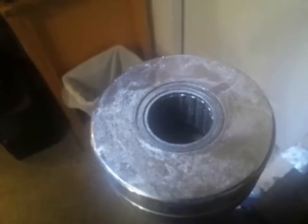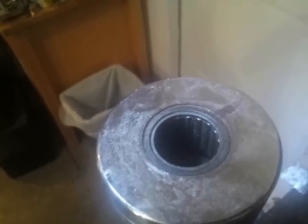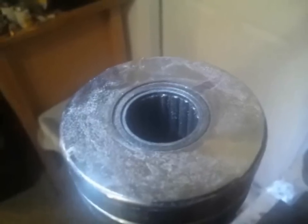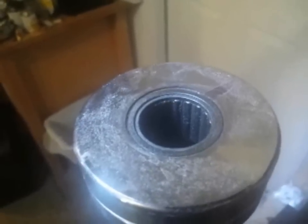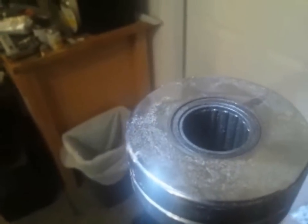This is the other side — the end of the barbell where the weight sits, toward the middle. You can see that bearing sits right there, easy access. You can just see the crud and residue there — it clearly started out with oil, still has a little, but that oil has taken up a bunch of chalk. It's gross. My guess is if I tried to spin it it would barely move. Let me check... it spins okay, actually not as bad as the other side which was basically completely dry.